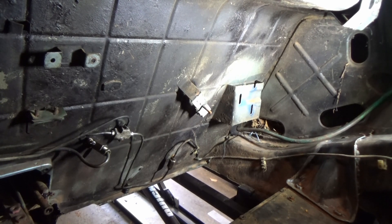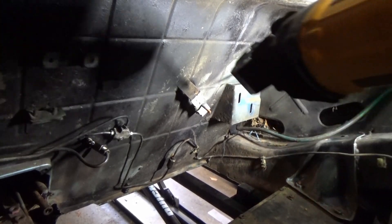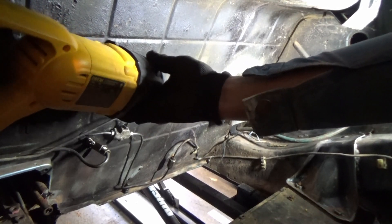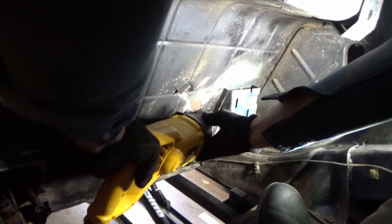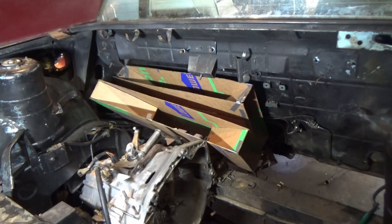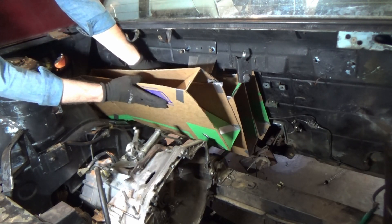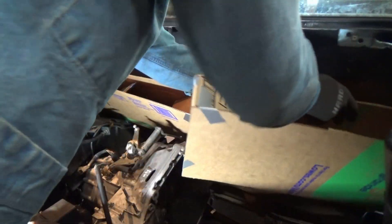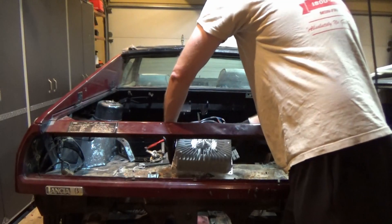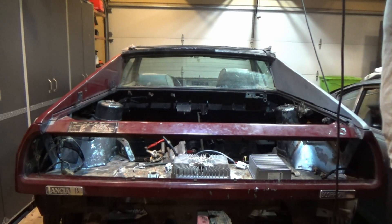And here's where I lose all the purists — all these mounting points need to come off for the batteries to fit. A lot of EV conversions talk about keeping it reversible so you could go back to the gas engine, but I don't subscribe to that belief because ultimately if you're doing that you're making compromises on the actual EV build. And if it kills you to see me chopping up this car, just keep in mind this car was nearly lost to time — it was sitting outside for 20 years. New plan: three batteries now fit on this side stacked horizontally with a little more cutting, and then two can fit on the other side, meaning all five are going to fit tucked up against the firewall. The charger goes in the center of what I'm calling the bench, then the DC-to-DC converter, and then the contactor box.